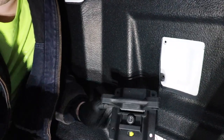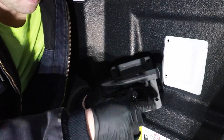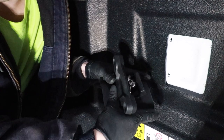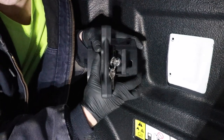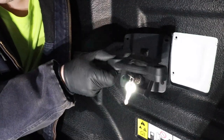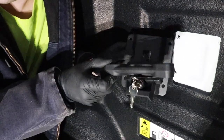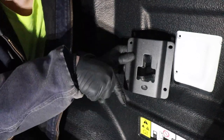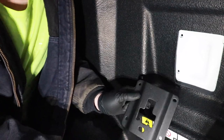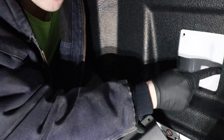To make this installation easier, remove the cleat from the bracket — take your key, quarter turn, lift up the latch on the bottom, and slide the cleat forward. This kit came with no instructions, but every picture online shows the lock cylinder facing down. So the oval hole faces down toward the bed. There are four mounting holes, and these are not pre-tapped. To the best of my knowledge, this is aluminum.